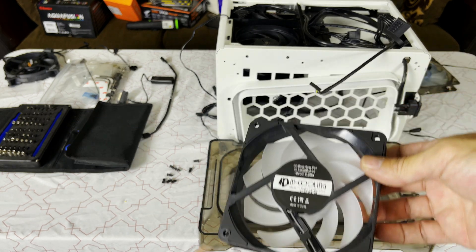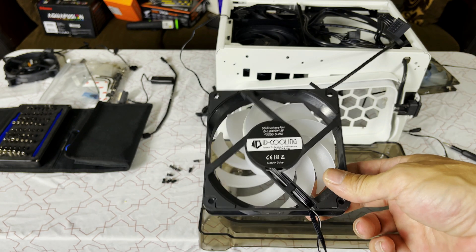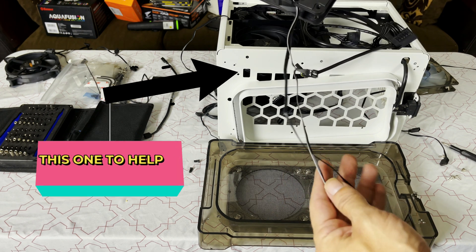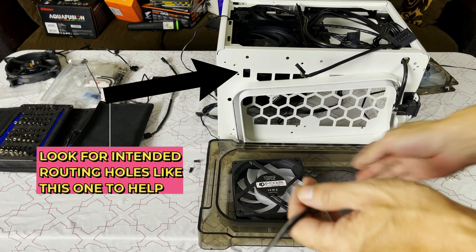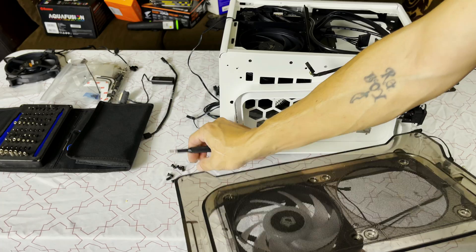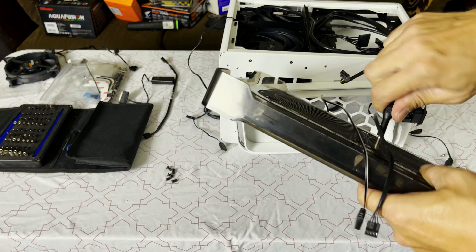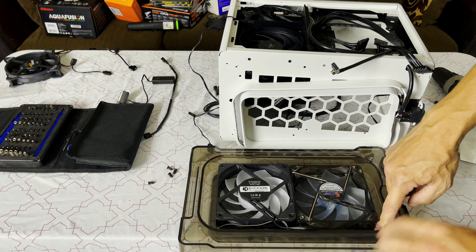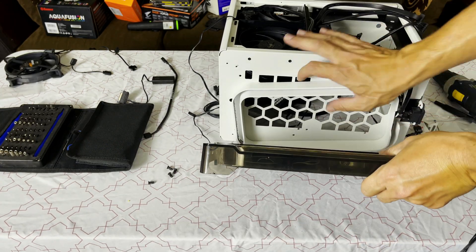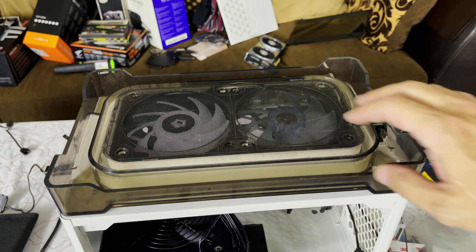Don't forget that the cage side here — these right here would be air coming through. We wanted this to draw in the air from the bottom up, so we're going to place them like this. Pay attention to your wires too — which way are they going, where are they going to come out from? Let's handle our first fan. Get your wires nice and situated so they're going to come out through this little gap here — there's a channel right there that's where they're going to come through. There are a lot of channels, so make sure everything is running through a channel or you're going to have problems.